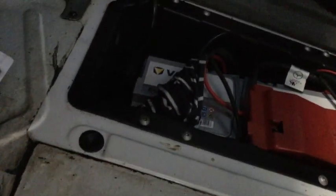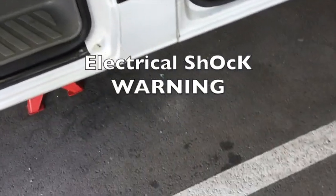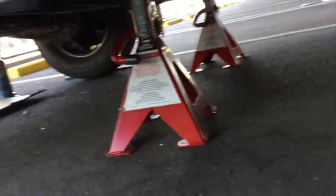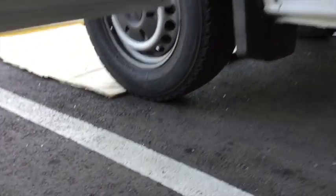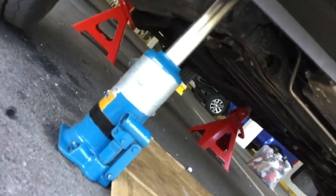The first thing you want to do is disconnect the battery negative lead and isolate it. This is really important because you're going to be dealing with the alternator, so you want to make sure your electrical system is isolated. We've got the wheel chocks on, the car is jacked up, and I've got axle stands positioned from behind the front wheels. The reason being, you're going to need a lot of space under the engine bay. The jack is positioned where the turbocharger is — your head is basically going to be right underneath the car there. So the axle stands and jack position there is just a safety measure.